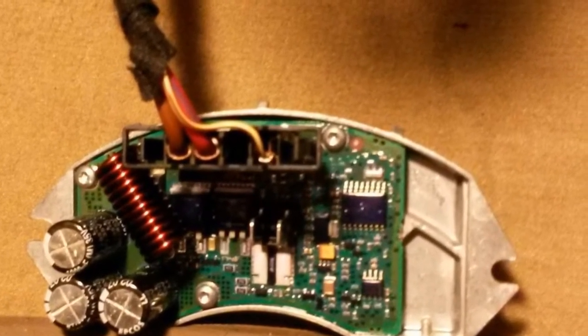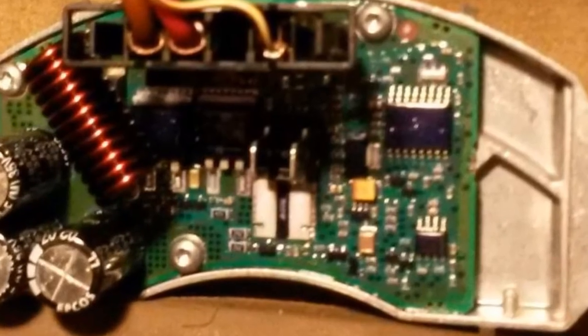This is the view of the final stage resistor where I remove it from the blower. I reconnect the cable and control it from the dashboard, and I can measure voltage from 0 to 12.